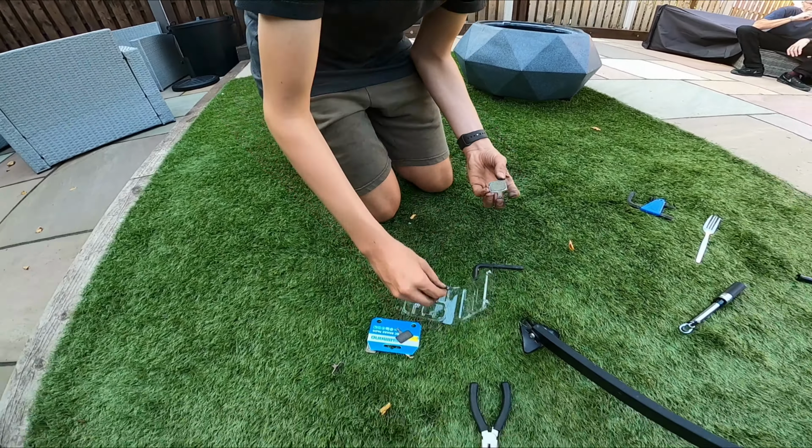Right, so now we'll stick them in. They've been really kind with me today. Usually they're like, faster to get in. And then you put your pin back through. And just bend that back, like that. There you are. Shouldn't really need to adjust this one, because we've not undone the caliper. You get your axle, just tease it in.